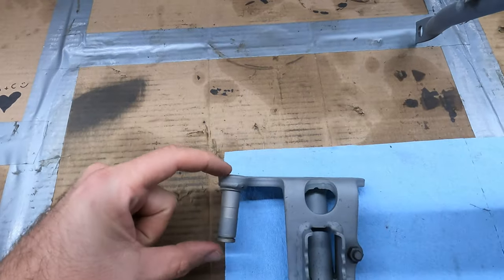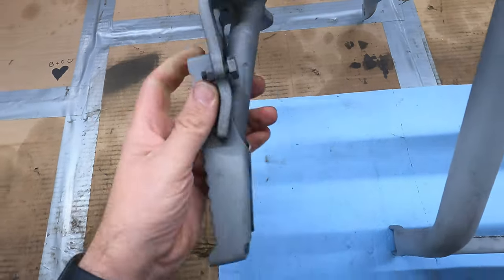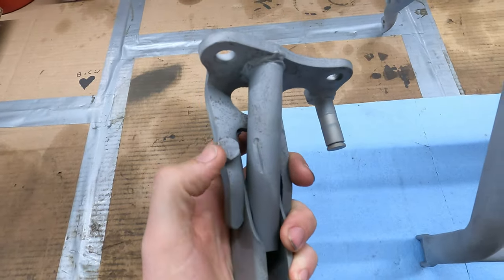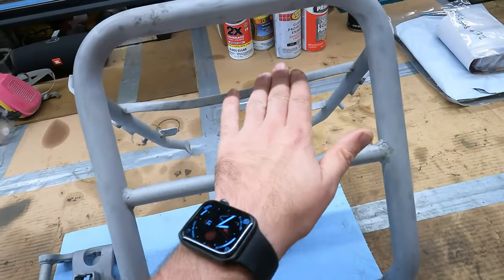And then this foot peg here — this ear here looks like instead of it being good and straight, it's bent out. And you can tell at the bottom the brake pedal has been hitting the tube here instead of this bolt where it should be. We're going to have to fix that. So let's start beating this around and see if we can get this flattened out.